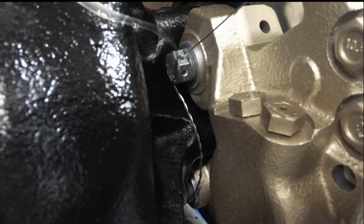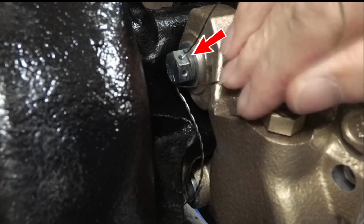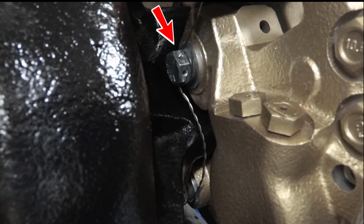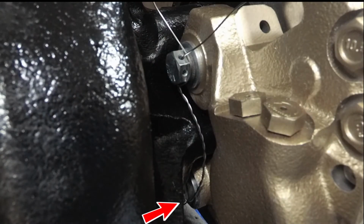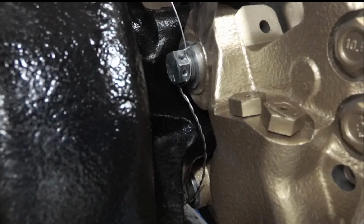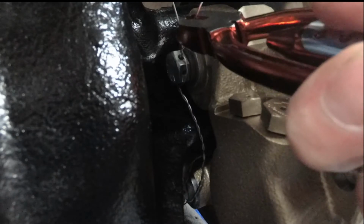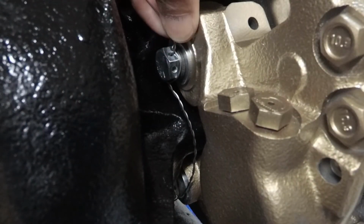off into a coma, you may have noticed that the lock wire is on backwards. The twist should be coming from the top of the bolt, roughly about, let's say 11 o'clock position, to keep the bolt from loosening. Looking at the holes at the bottom bolt, the wire should be entering probably, let's say about the 8 o'clock position. Of course, someplace it's really not easy to get to, obviously. The way it is now, if I tug hard enough on the wire, I could loosen the bolt, well, providing that there wasn't a lock washer installed too. Anyway, I noticed this while I was editing, which prompted me to hightail it to the garage and fix my screw up. I also bent the wire over so I wouldn't cut myself.